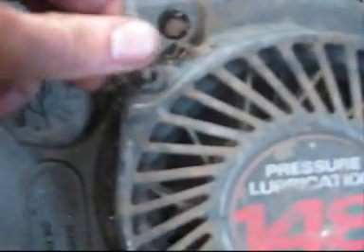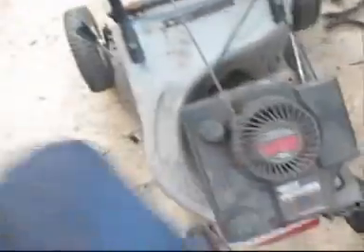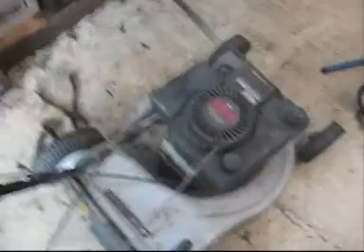There's like that little clasp thing that stops the disc from being pulled all the way in. I took that off and now it recoils all the way back in. I'll take that cover off and oil it. That was pretty easy, so now I've just got to take the carburetor off and clean it up.